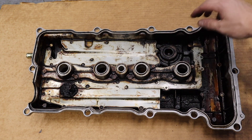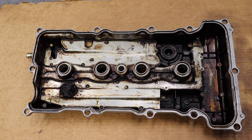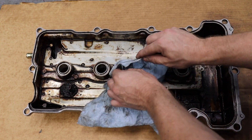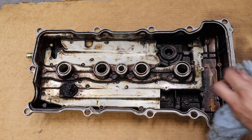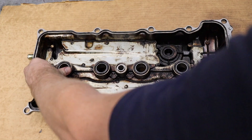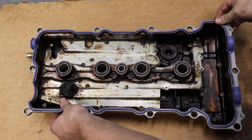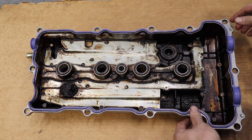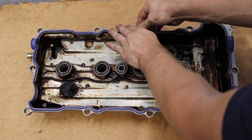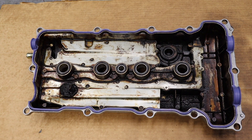What I did want to point out — if you're ever doing your spark plugs and you see oil sitting on your spark plugs, there's a good chance these little O-rings have failed. Start there before you panic about your engine. We've got our new kit here with all the good gaskets we're going to need, the O-rings. Go ahead and press it down into that channel all over. Make sure you have it lined up right and check for defects — you're looking for little pinches or imperfections, because finding them now saves you from installing it and seeing all that oil come right back out. Valve cover gasket is in place, ready to be installed.